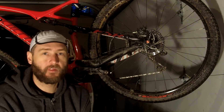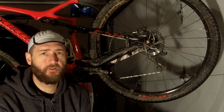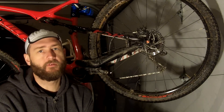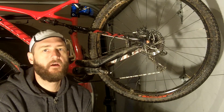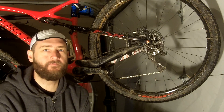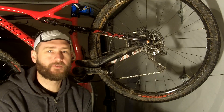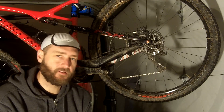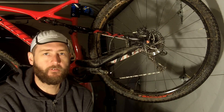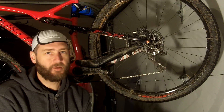Typically what I like to do is actually rotate the tires — put the new one on the front and put the used one on the back so that I've got a little bit of wear on it. That rear drive tire is usually where I pick up the most benefit from having a slightly more worn center. And of course you're steering with your front wheel, so that's typically what I do.